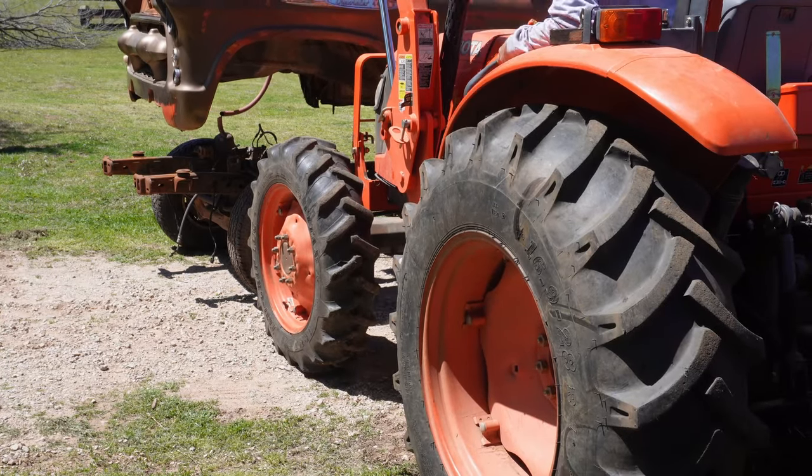And I just whacked off 17 inches on those frame rails. We'll add back in whatever we need to add back in. Right now I've got 2x4s spacing this thing up. The mounts that go on this, I believe, are 1 inch. So that's about a half inch higher than it's going to be.